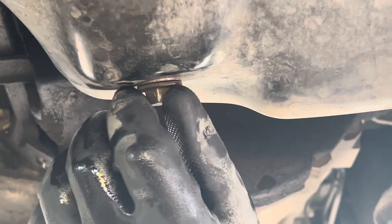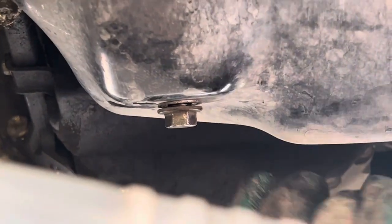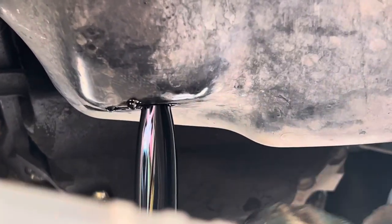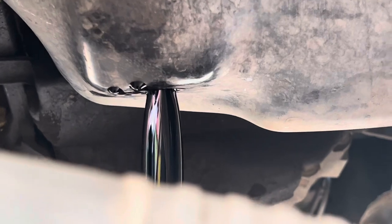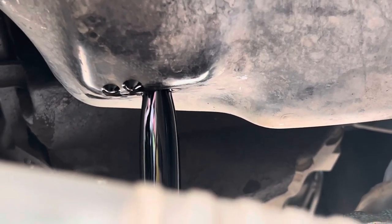Remember, it's just under 40 newton meters to tighten that. I'm going to put the bucket on again and drain, as I did with everything else. Let that drain. Brilliant. The next thing is to leave that there and come back in a moment when this has drained.